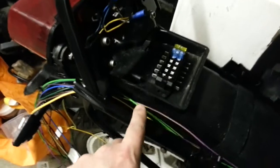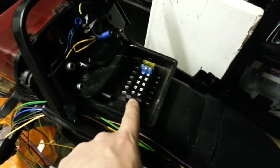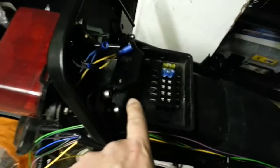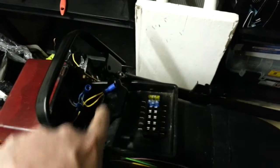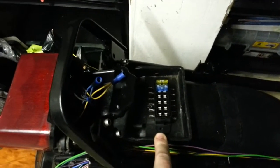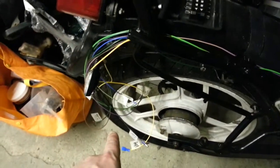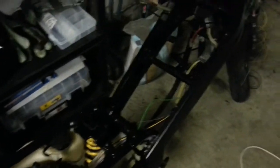So here we are back in the dark side of the garage - I need to get some more light in here. Here we have the cables run down to the front and then they run through the bike. This tray at the back - there used to be a tool kit in here - this tray at the back is where I'm going to be putting the fuse box and the relays. I'm going to take this out for ease of access, I need a couple of bolts. This is where I'm going to be mounting the fuse box and the relays in this section here. I've had to run all the cables up to the back and they're all labelled so I know what they do.